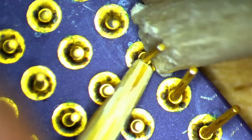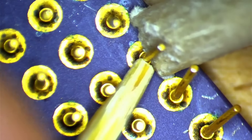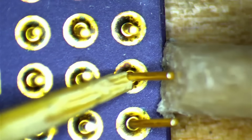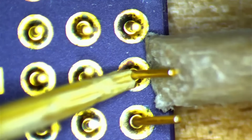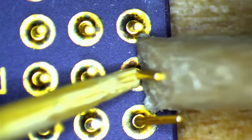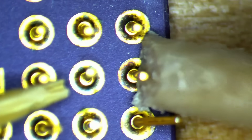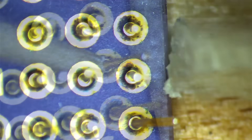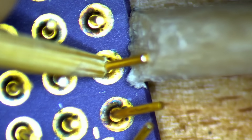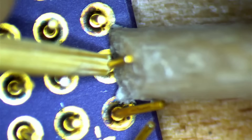As I mentioned at the beginning of the video, this CPU from Cyrix is based on the core of a 6x86 CPU developed for the Socket 7 platform. Borrowing from a later design gives this CPU some special abilities that are usually not available on other competing products. The only other CPU that possesses special features is, to my knowledge, the Pentium Overdrive, which uses a heavily modified Pentium core adjusted for Socket 3. Cyrix followed a similar approach and modified a later generation to be compatible with this older platform.